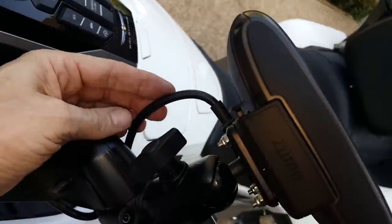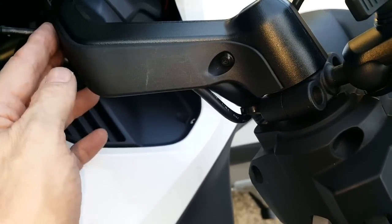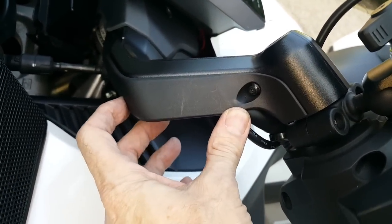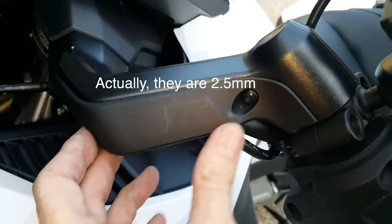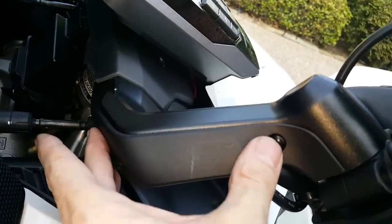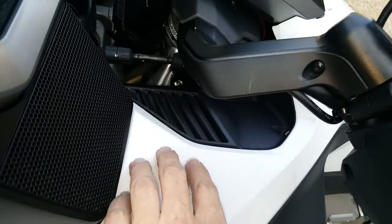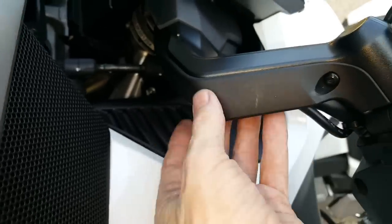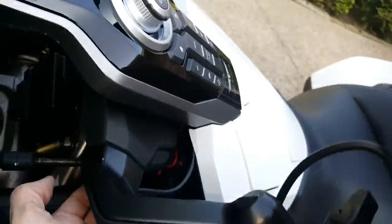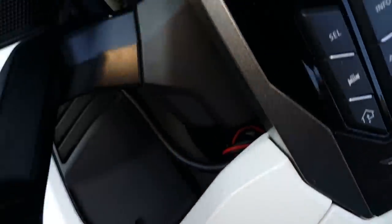I'm going to use some PlastiDip and paint the ends of the cut wires so they're waterproofed — I don't want those exposed and risking a short. I'll maybe wrap it with a little silicone tape just to make sure it's sealed. After cutting off the wires, I was able to get that harness to hide up under here — basically underneath the console in front of the little glove box. I actually took the wire coming out of the Zumo and ran it inside of this cover. There are two Allen screws — maybe four or five millimeter — you remove them and this cover comes off. Be careful not to scratch your paint with the Allen wrench. I was able to tuck the Zumo wire up here and it just comes out — it's not perfect but it's a lot better than it was.